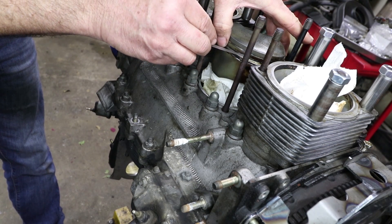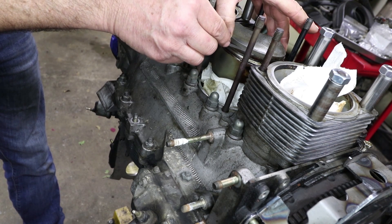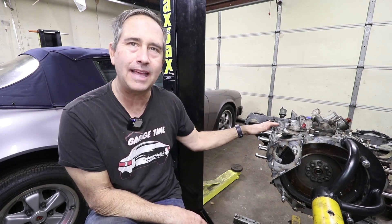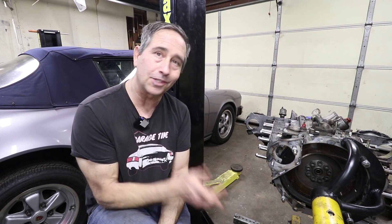The second ring is even tighter than the top ring — usually it's the top ring that wears the highest because most of the pressure is on it. I really want to put this together, but I don't want to rush it. I want to clean the piston really well, clean the cylinder bore again, and make sure there's no grinding dust from drilling out the exhaust studs. Engine building is more about cleanup, inspecting, and sourcing than actually building. Those exhaust studs were difficult — guaranteed. See you guys next week, thank you for watching, cheers.